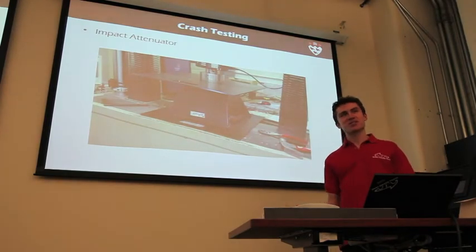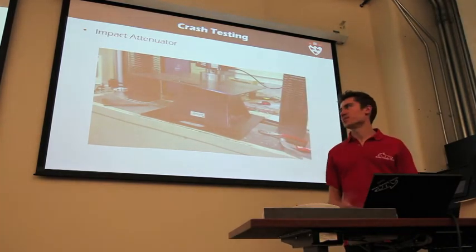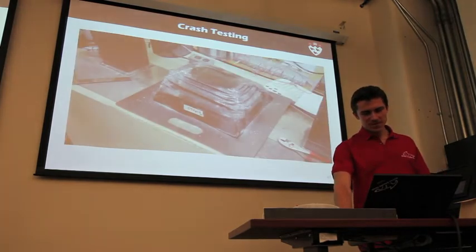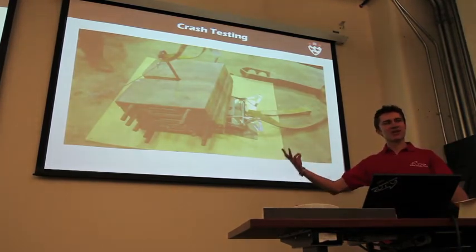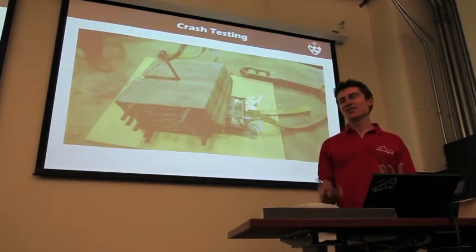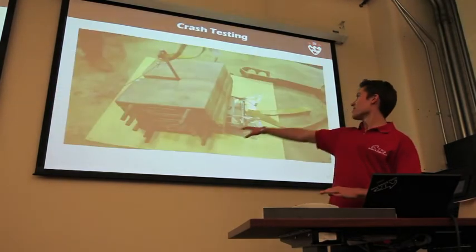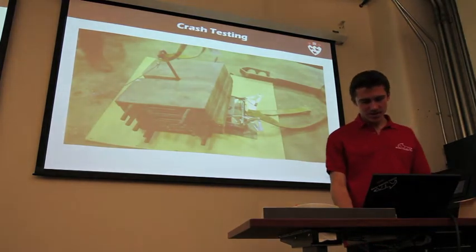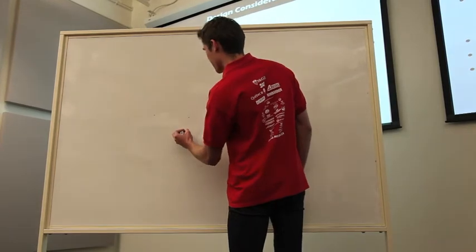At the front of the car there's something called an impact attenuator. If you get in a head-on crash, this absorbs energy and decelerates the car more slowly. Last year, we tested a bunch of different ones. You can test it statically — we just crushed it very slowly — or you can test it dynamically. In this case, we dropped a fair amount of weight and figured out how much energy that would take, attaching an accelerometer to the weights to figure out what sort of deceleration there would be. That weight would be similar to what the car weighs. That's a mock-up of the impact attenuator and the front of the car from last year — you can see the brackets for the wings included in the test.